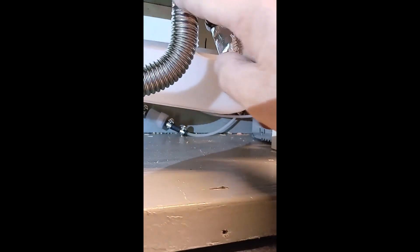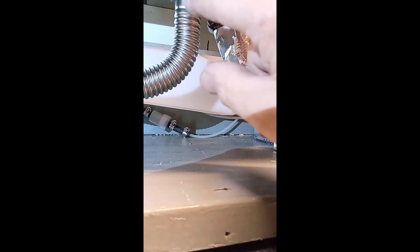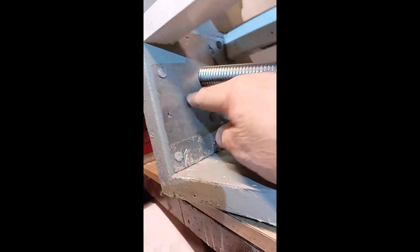Exhaust's out there. I've trimmed the top end of that a bit so you can push it up further, so you've got less going down to the bottom — it's a bit higher up. Steel plate on there, and then a bit trimmed off to go in the end there, just bent round and pushed in the hole. Screwed on there — a bracket there for the exhaust.